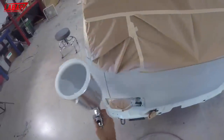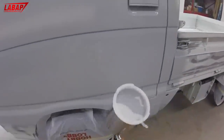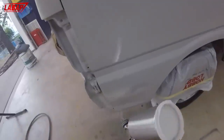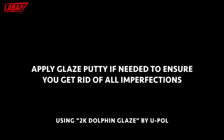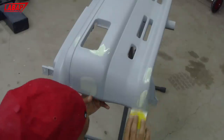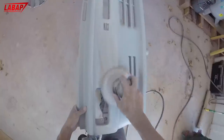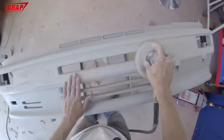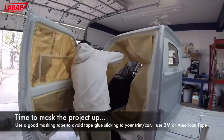When you lay the second coat on, make sure the first coat is dry — you don't want to spray a second coat over a wet coat. Give it about 15 to 25 minutes depending on ambient temperature. Once your primer is done, go over all your work with a little bit of glaze putty for any deep imperfections, pinholes, or scratches. Then use 320 grit to cut down the orange peel and glaze putty, followed by 400 grit wet sand before masking up for paint.